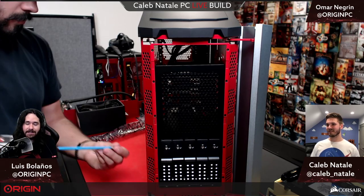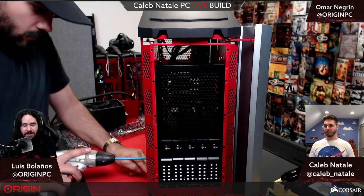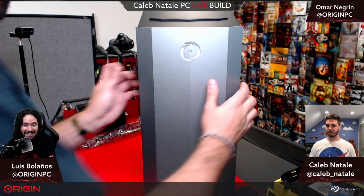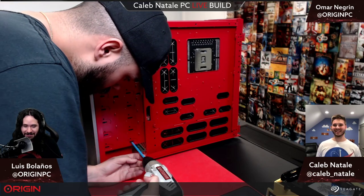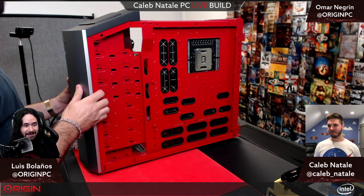And again, the easy access hot swap bay there makes it easier. Instead of having to open up the computer, you can just use the hot swap bay. I know for me personally, when I've worked with a hot swap bay, I'm like, oh man, this is so much easier. Let's say I'm out of storage, or I need to transfer to a new hard drive. I just slide out the tray, insert the hard drive, put it in, run the software, and you're good. I'm like, whoa, that was easy.